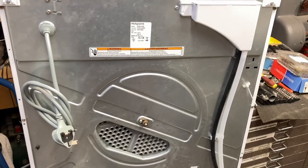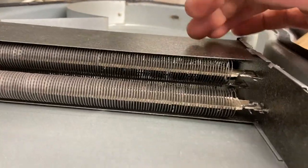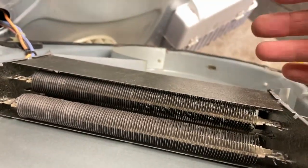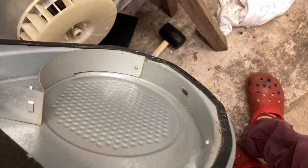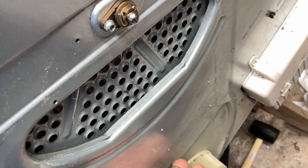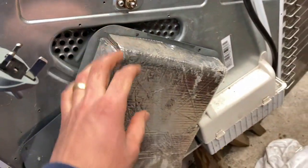Now let's have a look around the back. Because it was damp inside when I got it last week, I thought I'd take off the back cover and just check that the element is okay, because this is the bit that tends to be gone on them. But this looks really spotless — there is nothing in there. And if they get damp, those mica cardboard things that hold the element apart can fall apart, but it all looks okay, looks pretty good. A bit of dust on the side but really nothing, no big gobs of something at the bottom. Fan turns — I'll demonstrate that — fan turns and then the drum turns with it. Bearing's not worn, it's not hanging or anything like that. So I'll put the screws back in and the shroud back on and we will get it cracking.